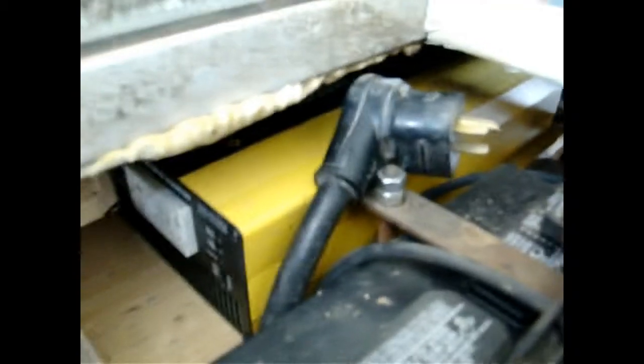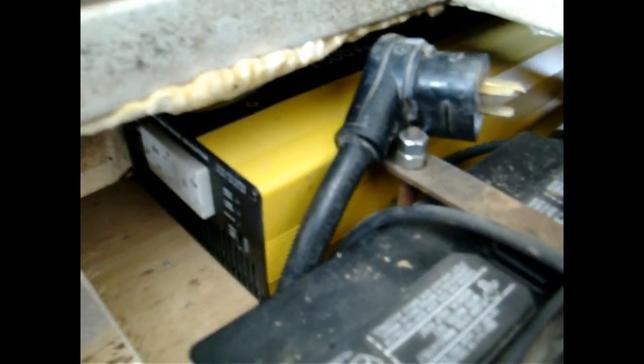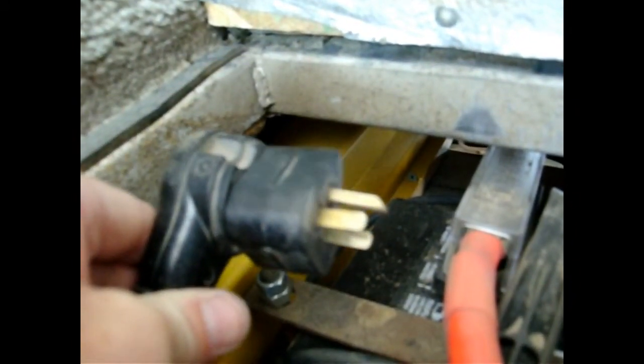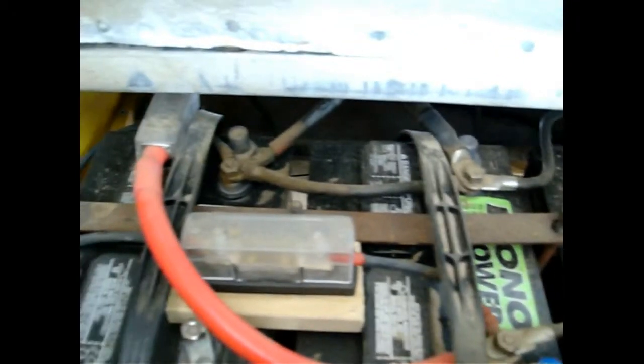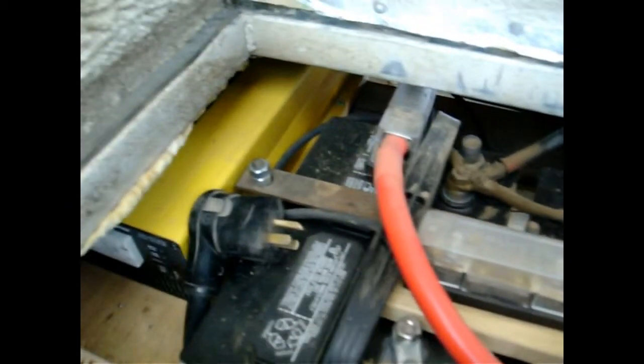I have a Go-Power 1500-watt high-surge inverter. I just plug my power cord into the outside of the coach just as though I were plugging into the house, so I don't have to rewire anything. However, you have to make sure you turn your charger off, because you don't want your inverter trying to charge the batteries while it's pulling power from them. I'll automate that someday — right now I just have it on a separate breaker and make sure that breaker is off.